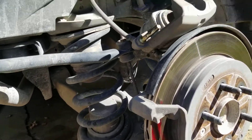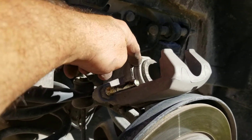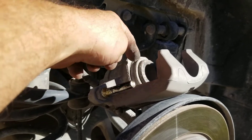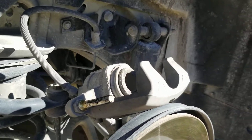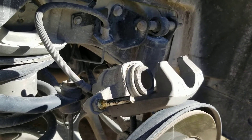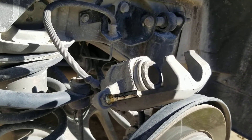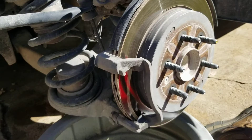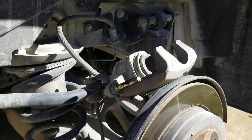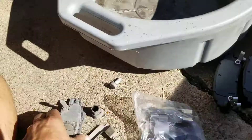I need to depress my caliper piston. I'm going to clean all this up — this car goes down a dirt road a lot, so I'm cleaning all that up. Make sure you pop the cap off of the master cylinder so you don't pressurize it and have it blow out everywhere. Put something under the car to catch it, because if you have extra brake fluid coming out it will go on the ground and contaminate it — we don't want that.